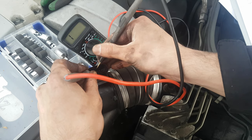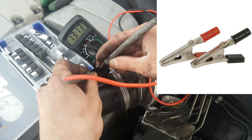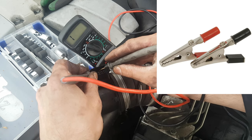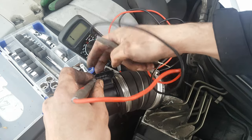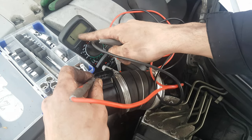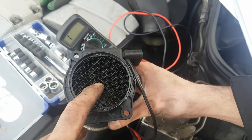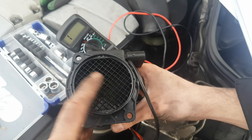Another test you can do is between the mass air flow sensor signal wire and the power supply wire. If you have alligator clips, hold them on the pins and try to tap on the mass air flow sensor — there should be no disruption in the continuity. If there is a disruption, it means that a hot wire is disconnected or is half-connected and moving in air.